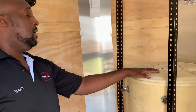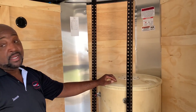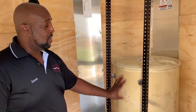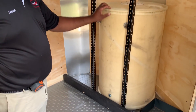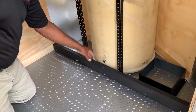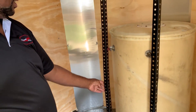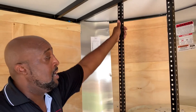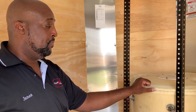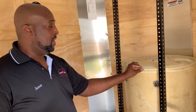What we did was we caged in our fresh water tank. As the trailer moves, I didn't want it to be able to fall. We'll set it steady. I'm probably going to put a wrap around here to hold it in place. What we did was we took a tube out, ground it in, and then took just two metal pieces — I actually had to make them longer, put some screws in each one. We bolted it to the top, which gives us a sturdy cage for our fresh water tank. I'll bolt it in later and it'll be totally sturdy.